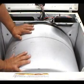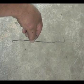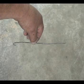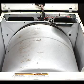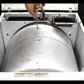Turn the drum until the screws on one of the baffles are in the up position like this. Get a piece of coat hanger wire about 10 inches long, make a hook on one end and a 90-degree bend on the other end. Unscrew one of the baffle screws until the head is about a quarter of an inch out.